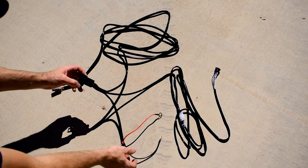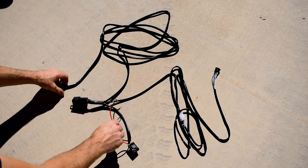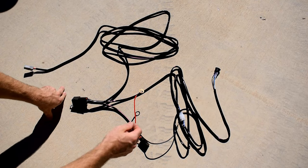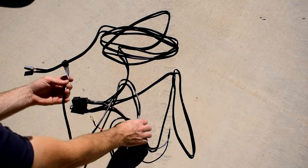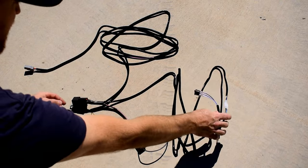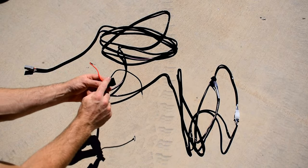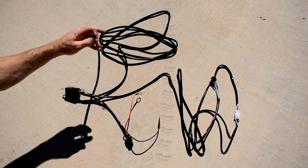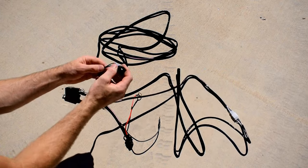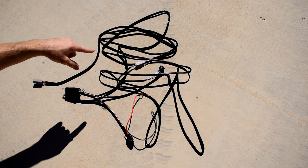This is the wiring harness that comes with the Aux Beam light bar. It's got really thick, heavy-duty wiring and also waterproof plug connectors, which is really important. It comes with a little switch and a joint so we can push the wiring through the firewall. Basically we have a relay, a power wire, an earth, and a fusible link, plus a plug which goes to the light bar and a switch that can go into the dash or inside the car.